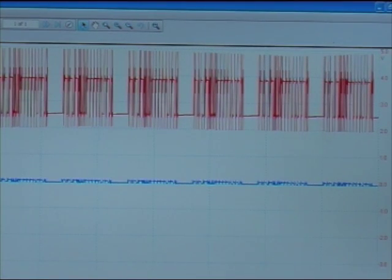The final test we carried out on the CAN network was again between BSI and ABS, but this time measured at the ABS multi-plug. Here we can see the high CAN was fine, but the low CAN had little or no activity on it.